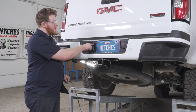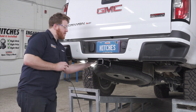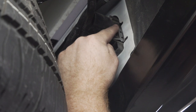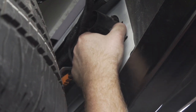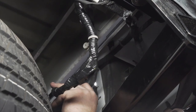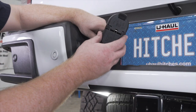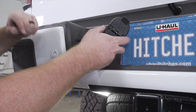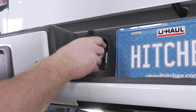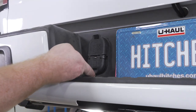Now on our bumper, this is where our trailer wiring will plug into — we just need to remove this housing. We're going to go behind our bumper to do that. On the backside of our bumper, to remove this plug, we have two metal tabs on both sides. We're going to push them in and that will allow us to remove it. We're going to take our connector and plug it in just until you hear that click. It has the same exact metal tabs as the other housing, so this will just lock into place. And then you're all set and ready to tow a trailer.